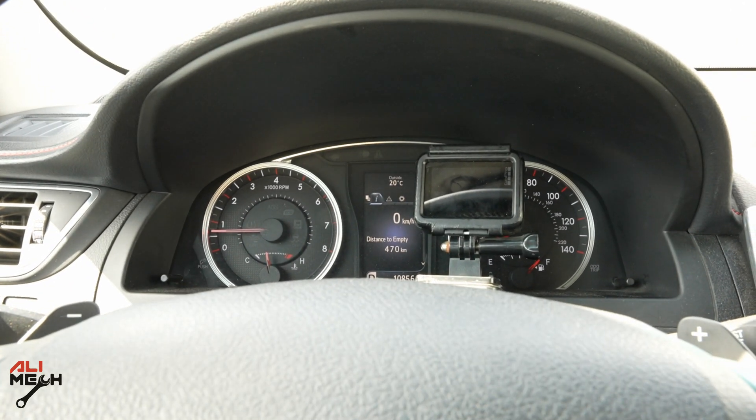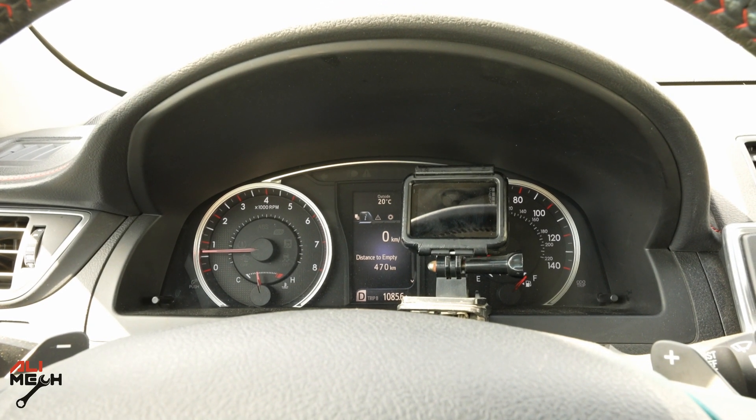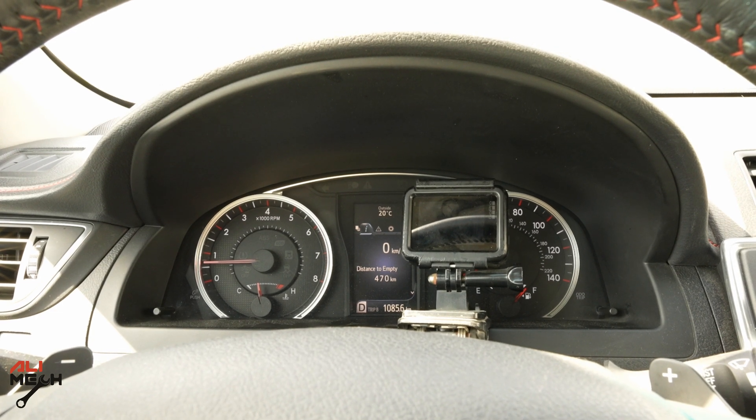When designing the mass airflow sensor bracket on this pipe, it has to be positioned exactly in the middle — that way it will give us the most accurate reading. If it's above or below it will give us a wrong reading and we will lose horsepower. With the stock filter intake, I'm gonna do a few pulls so we can know how long it takes from 0 to 100 kilometers an hour. I'm gonna do three pulls and take the average from them.